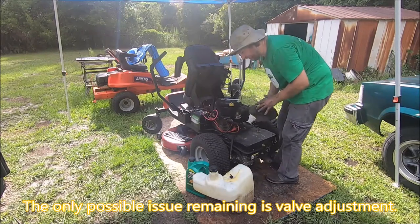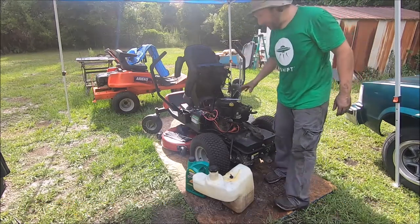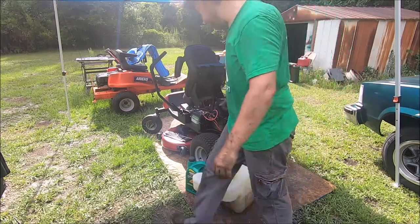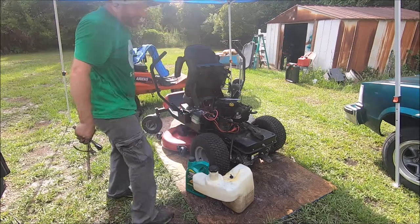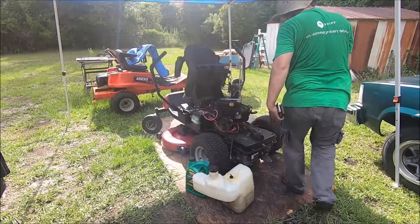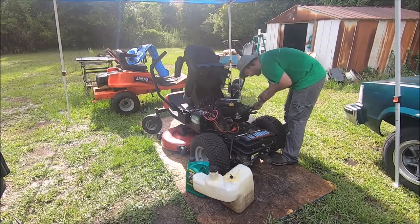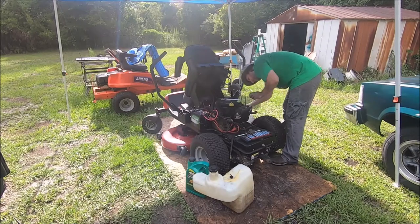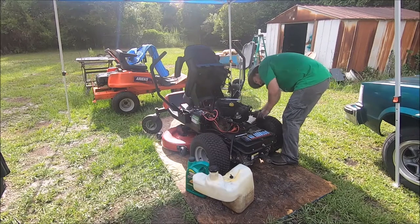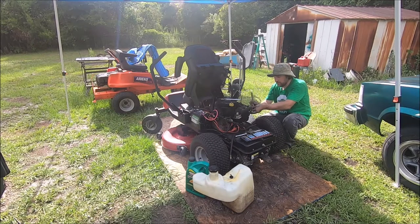Well, she's got new bolts. That's not a good sign. I don't know if I said it before, but I have my suspicions somebody was into this engine before, probably with the same problem. Clearly someone has pulled the engine before. I don't think this valve cover gasket's original either. It looks like RTV. These bolts are grade 8 and brand new. So, yep, let's take a look.